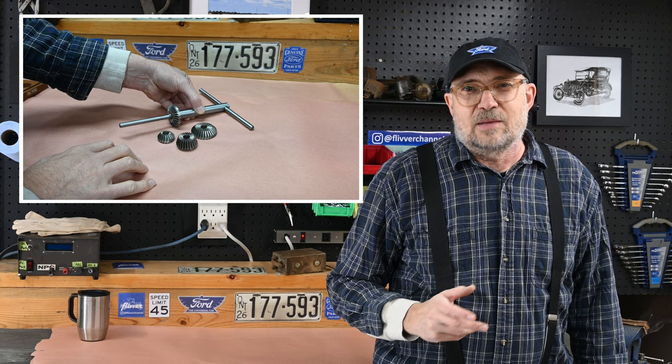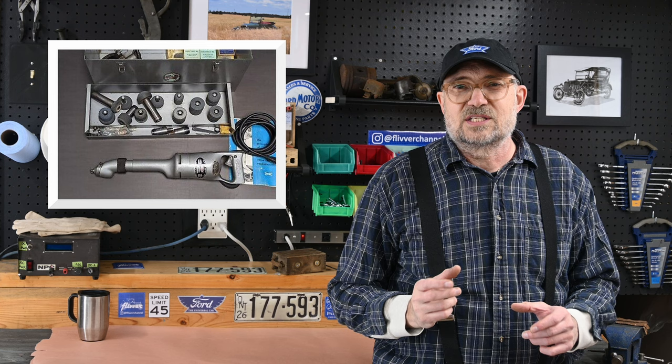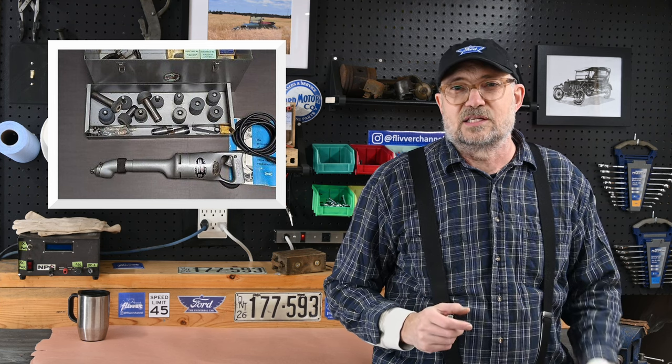Note that I couldn't just lap the valves in again like many people do, because I was using larger valves and because the old seats were worn down so deep. There are some wonderful tools available for recutting valve seats, but my pockets just aren't that deep. I bought a set of high-speed steel valve seat cutters, and it's kind of cool to be doing it just like they show in the old manuals — I was thrilled with how smoothly they cut. I was lucky to borrow a Sioux valve seat grinder and used it just to touch the conical seating surface and put nice, circular, fine lay lines into it.